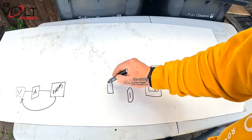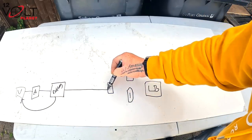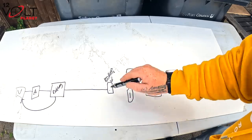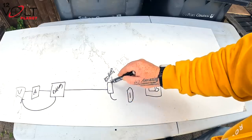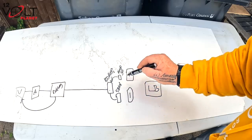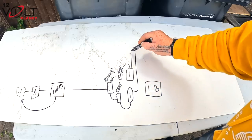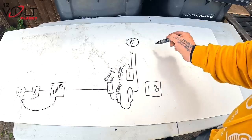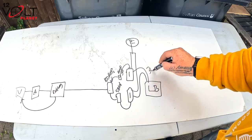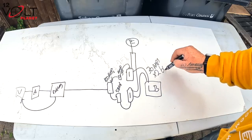We've got a splitter there and then we pull the 35mm cable from there to the splitter which is a 100 amp mega fuse. We've come off the 100 amp mega fuse with two feeds going to two 50 amp fuses which then go in to each Orion. Each Orion is also independently connected to the earth of the van. From each Orion go in to the battery, putting in 30 amps each. Times that by 2 gives you 60 amps.